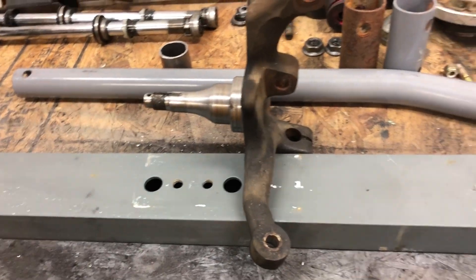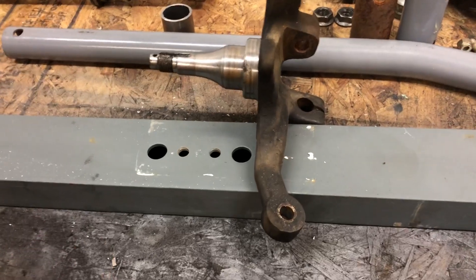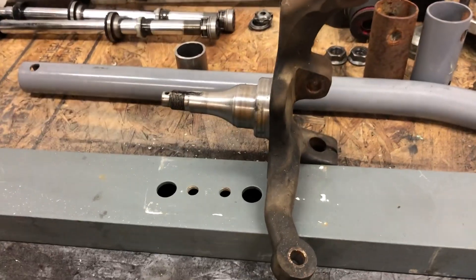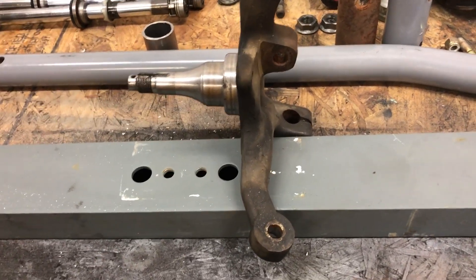I think with these I'll take that into account when I model up my front suspension, so that when I'm at a 16th toe out my Ackermann is where I want it to be. I've heard the car will drive really weird at zero Ackermann during normal grip and initiation. I really liked how my car initiated once it was set up correctly, so I don't think I'm going to go with zero Ackermann.